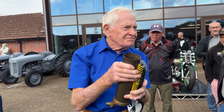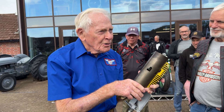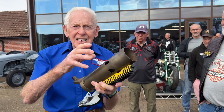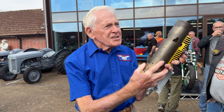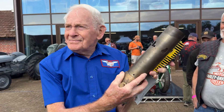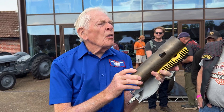So what happens when it's red hot? It expands. This end is in the crankcase, which is cool. So what happens there? It contracts. So you've got a tremendous differential in temperatures. So the top seizes in the bottom, so they used to have to put big clearances in here to cope with that. And that led to, really, an oil burner.